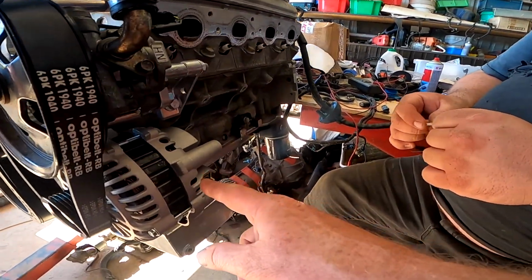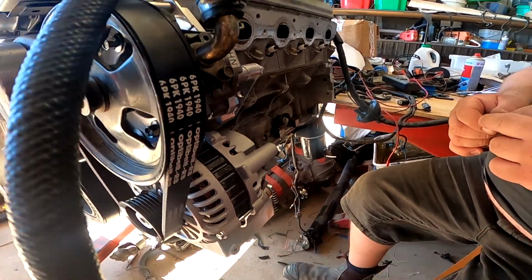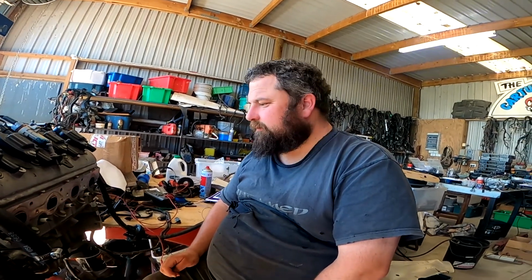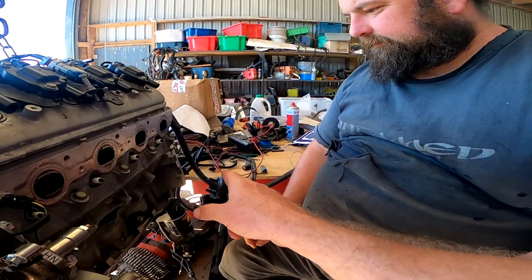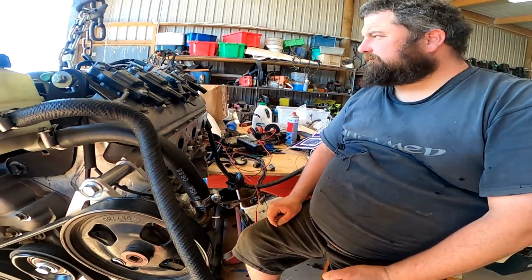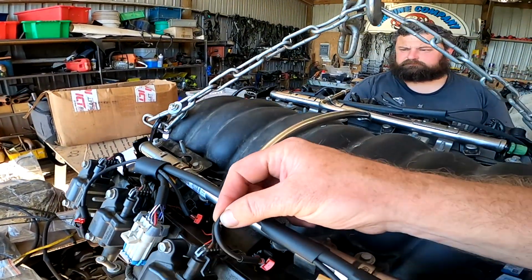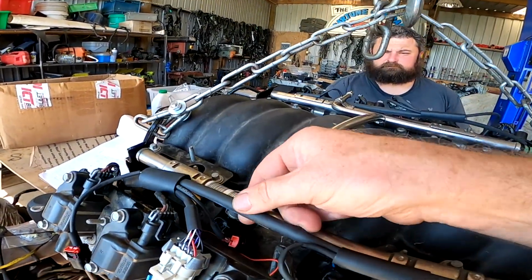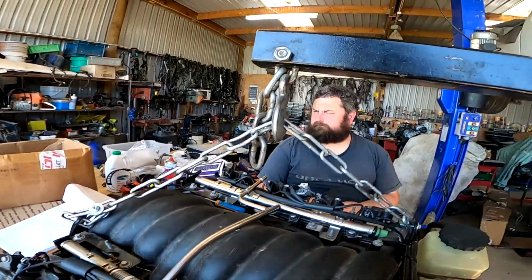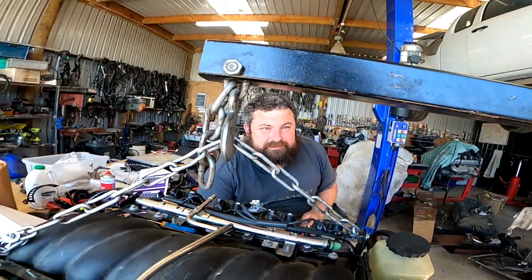Did I say that the alternator's a normal alternator now? So it integrates better. It hasn't got the clutchy thing on it. It doesn't have computer control, it's got a different regulator. As you can see, we've got a factory grommet to go into the firewall. This is all finished in Tefzel wire, with Raychem Motorsport heat shrink to cover it, because we're not building a race car. We're also building reliability. It's going to be more reliable than anything else we put on it.